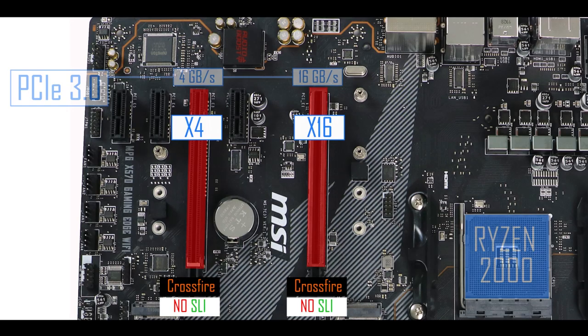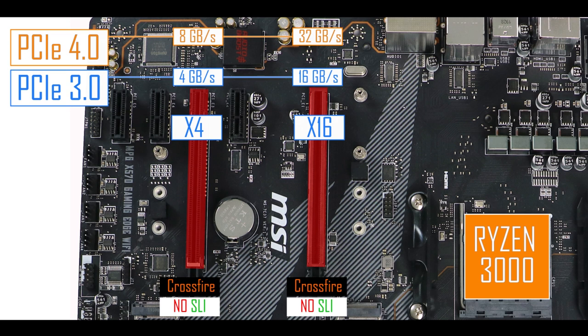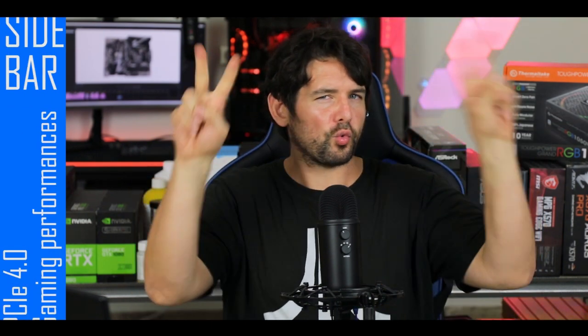That lack of reinforcement would be a bigger concern on PCIe 3.0 — but going from PCIe 3.0 to PCIe 4.0 means going from 1GB/s to 2GB/s per lane, giving the second x16 slot more bandwidth than needed to operate even a 2080 at optimal speed. Still, I would have loved to see metallic reinforcement on that second x16 slot.